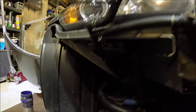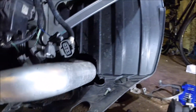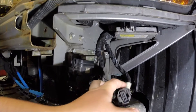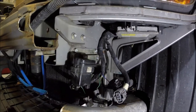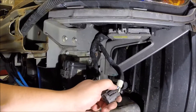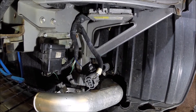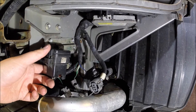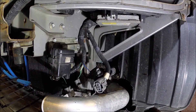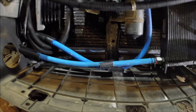So that's what I've been doing — I've disconnected most of the intercooler pipe and been measuring things up. I've also removed the air pump. I'm a bit disappointed really because I was hoping to use the air pump's power supply to run the charge cooler fan on the heat exchanger and the water pump, but this plug is live all the time, which means effectively my charge cooler pump and fan will be running all day until the battery's flat. I'll have to look at sorting something out — probably a switched live to a relay that I mount here which will switch on as soon as the ignition's on.